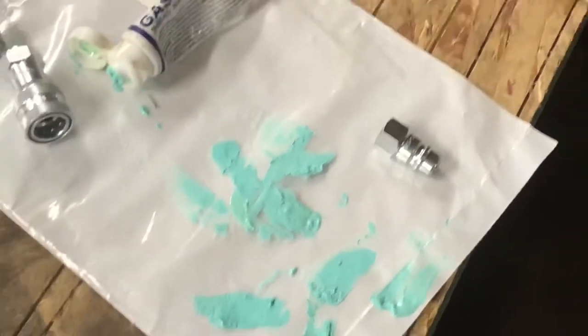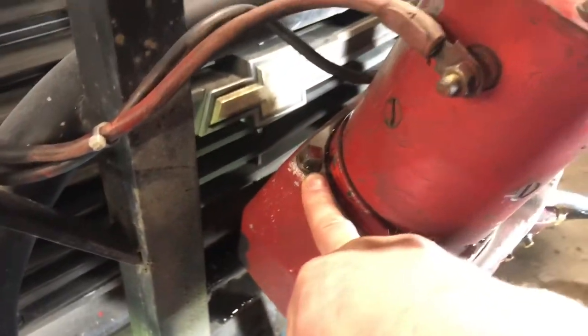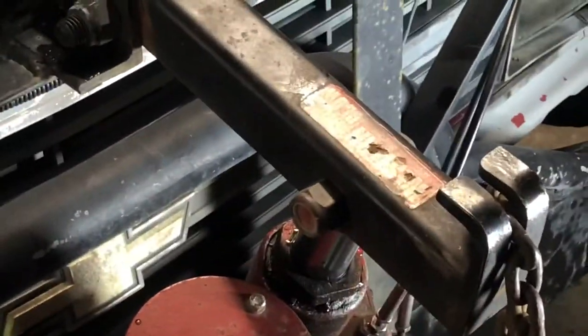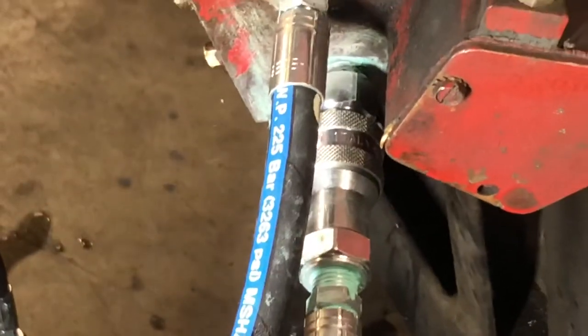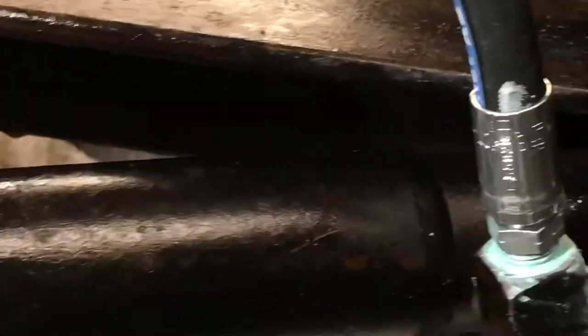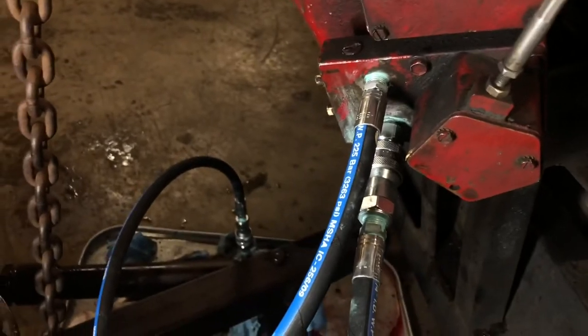The next video will be the complete setup, then I'll refill the reservoir. This is a Drag Mark 3A, which is the technical term for this cable-driven Western setup. We are plugged in and locked and loaded — upper and lower, left and right quick disconnect lines. Down here at the original breakage we have a fresh fitting, cleaned threads, sealant applied, and brand new quick disconnects.